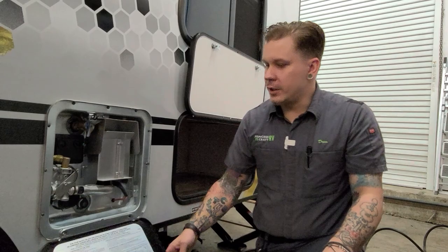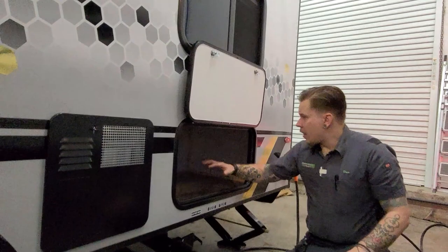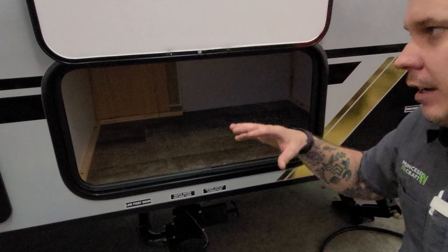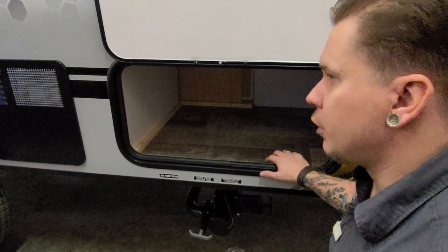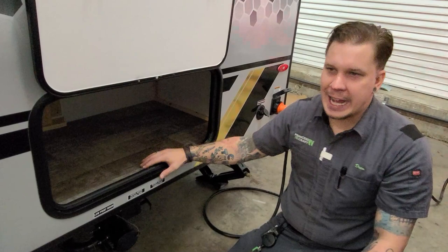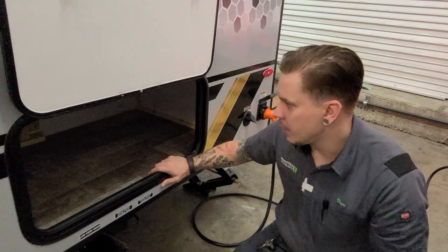When accessing or closing the water heater door, just line everything up and have the latch transition through the slot, then pull towards you and rotate it 90 degrees to lock the door shut. In the next compartment, if you need to access the water heater for maintenance or to bypass it for winterization, you can do that right here by removing two screws, or from the bunk on the inside by removing the mattress and the screws holding that base board. If we are doing a full winterization process, we want to make sure we bypass that water heater before introducing antifreeze into the system.